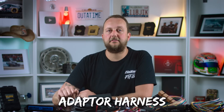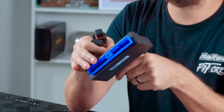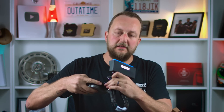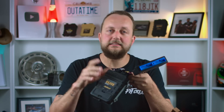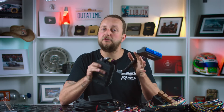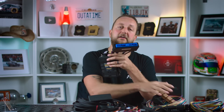Next up we've got one of the easier styles of installations — probably the most popular of the patch harness style — and it's our adapter harness kit. This is a short adapter harness that has a female factory ECU connector on one side and a Haltech ECU connector on the other side. Simply remove the factory computer, plug the adapter harness in, then plug your Haltech ECU in. Load a base map straight out of the software and you're ready to tune. Using an adapter harness is a really clean and simple installation method, but it does require your factory wiring harness to be in really good shape. If the car has problems in the factory wiring harness, fitting an adapter harness is not going to fix the problem — it'd be best to replace the harness or fit one of our flying lead harnesses.